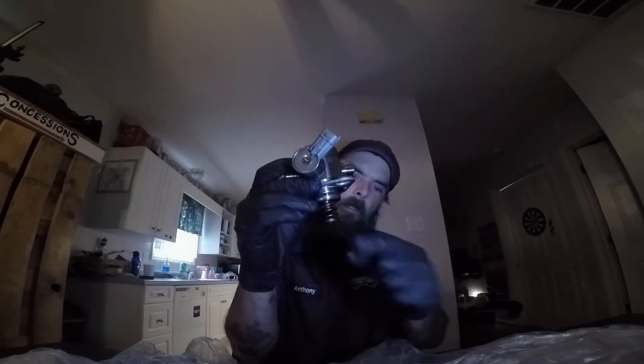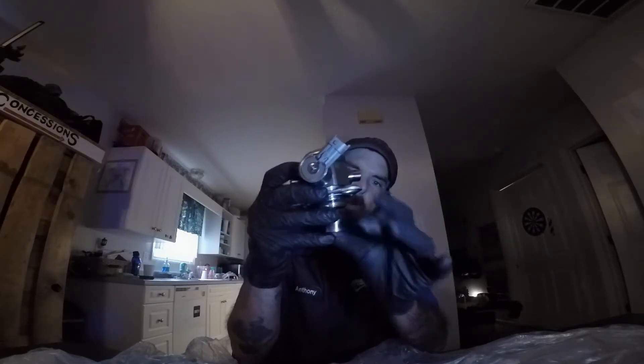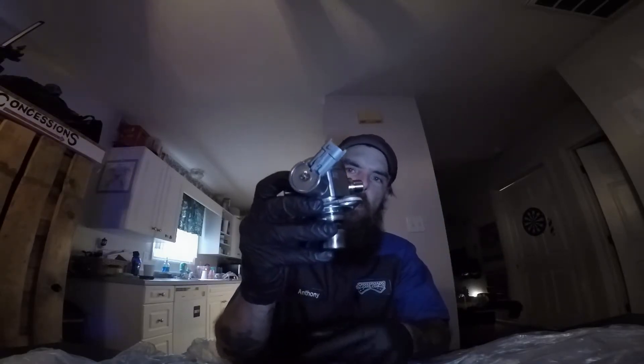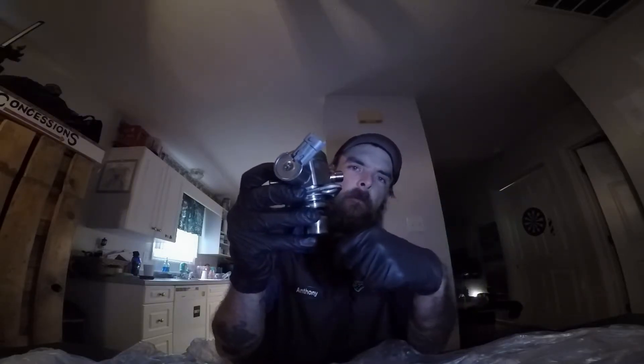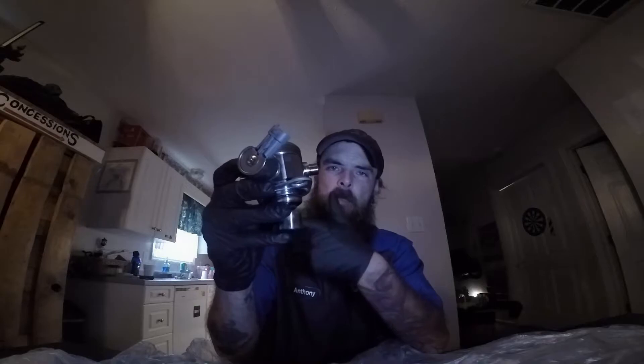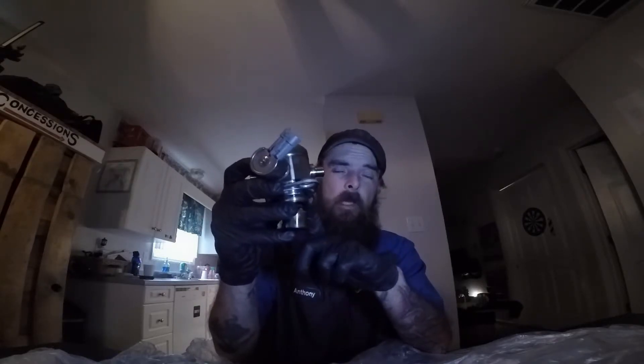There's a chamber inside here and it's filling up with fuel. This has a spring on it and it sits inside of this bucket, which sits on top of the camshaft. This pressure sensor is talking to the PCM. The fuel pump in the tank is about 49 PSI, give or take. These are upwards of 2,000 PSI.